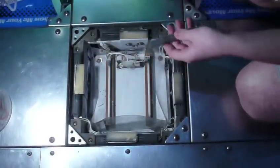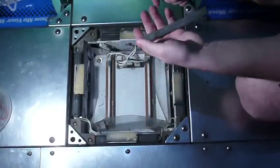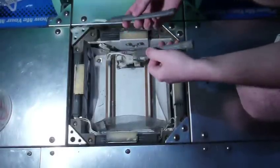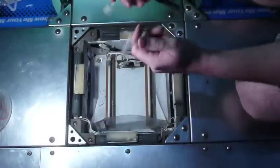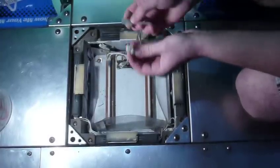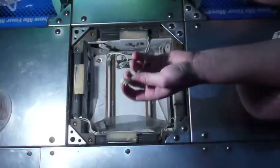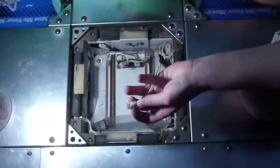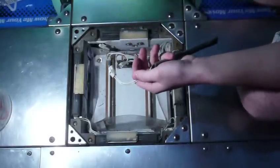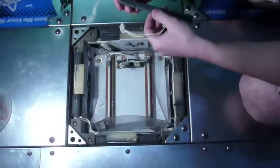Okay. Now, this is a DDR sensor. This one is working, so I'm going to be moving this one. And this is a Pump It Up one. The first thing you'll notice between them is the connectors are different. They're not interchangeable. You can't put this connector into there. You'll have to either solder them apart or solder this connector to this one, which I don't recommend doing. I'm going to show you a different way that requires no soldering.